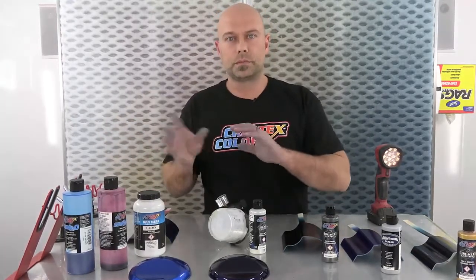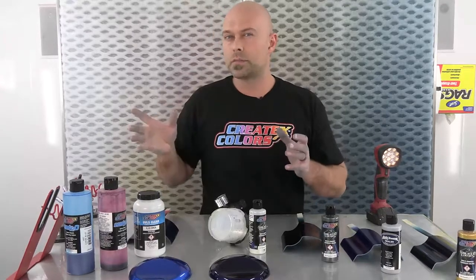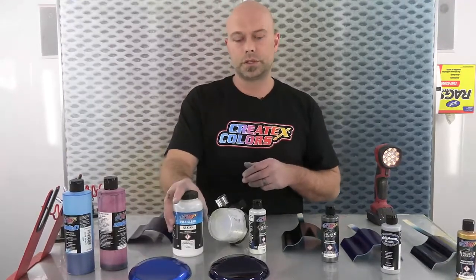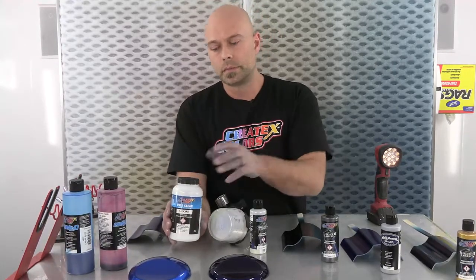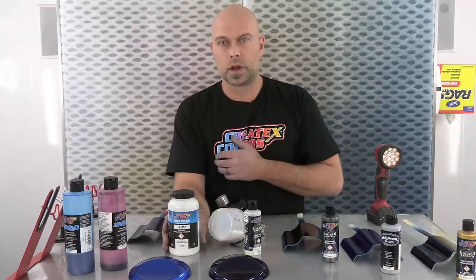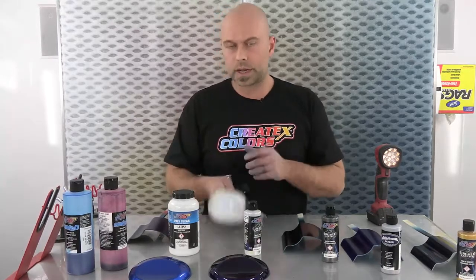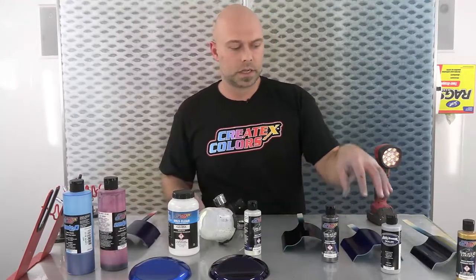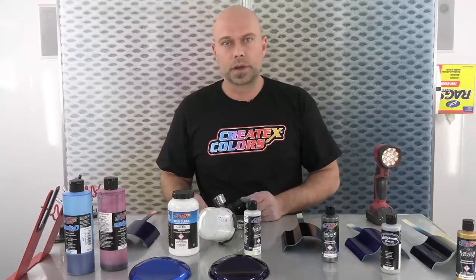The Flare Blue Violet is going to key well to both ends of that color spectrum. This is not for real color saturation — two to maybe three coats max, just a medium effect coat, a control coat. For a pearl color I like mixing it at around 25% of the 4050 in with the paint, so about three-to-four parts to one part — that seems to be a good ratio between 20 and 25%. It really helps spray ability and elevates that pearl effect flick. I've got some in the gun and I'll put a couple coats over the blue here over the silver sealer so we can really compare what it does to the neat clean one.